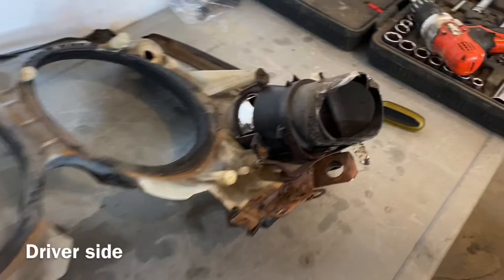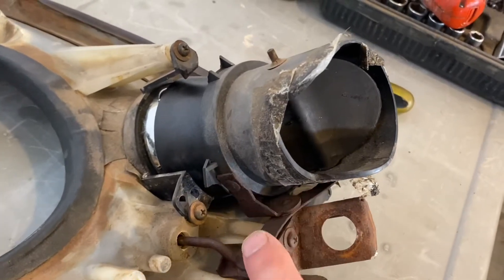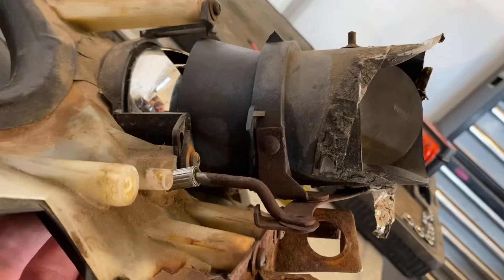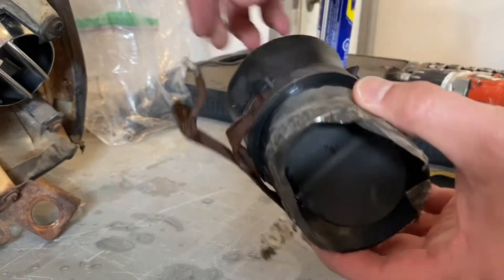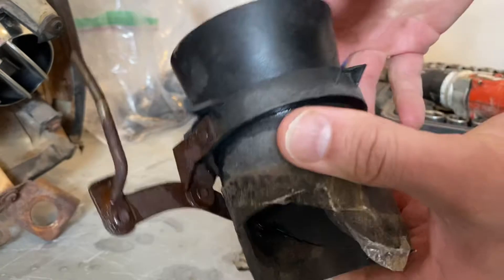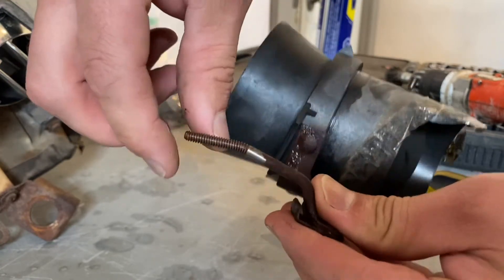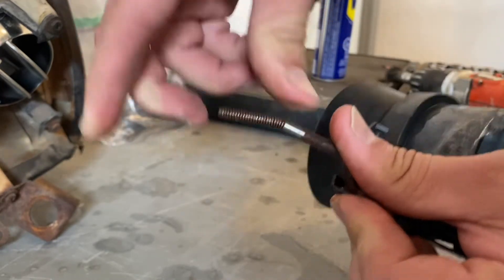So now moving on to the driver's side. As you can see, this is all broken. We're going to do the same thing — clean all this with the wire brush, WD-40 it, get it moving. I also noticed that this rod is even bent. Somebody pushed it too hard and bent it. So what we're going to do is unscrew this little handle and pull this whole thing right out. We greased it all up and it's already working. Now we're going to bend this straight — it's not going to be easy, hopefully we don't break it. I'm actually going to heat it up with a propane blowtorch, grab it with something, and bend it straight.